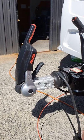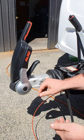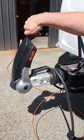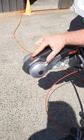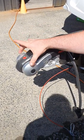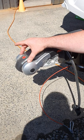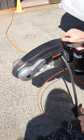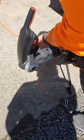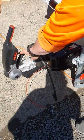On the lock system, push the little black lever up — it stays in position as you lower the van onto the vehicle. The tow ball goes into the coupler and the lever snaps down to confirm connection. Then push the secondary lock down — a red button pops up and shows a green ring to confirm it's properly secured. This secondary lock has two pads that squeeze either side of the tow ball as a stabilization system. To remove: lift the secondary lock, hold the black lever up, and use the jockey wheel to lift it off the vehicle — hold the lever while winding up.